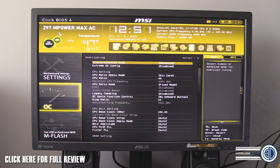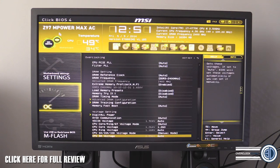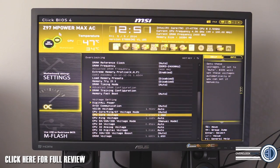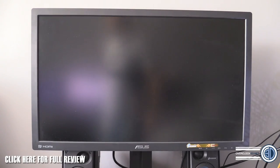Now for a quick look at the BIOS — this is pretty much what we were used to with the old gaming boards and the Z87 BIOS, so if you were used to it before you'll be familiar. I just wanted to point out: don't copy my settings because all CPUs are different, and my 4770 is a golden chip. The likelihood of you being able to copy these settings and have them work is slim to none. I've got 1.26V core voltage — I'll just F10 and clear that out and let it boot into Windows.